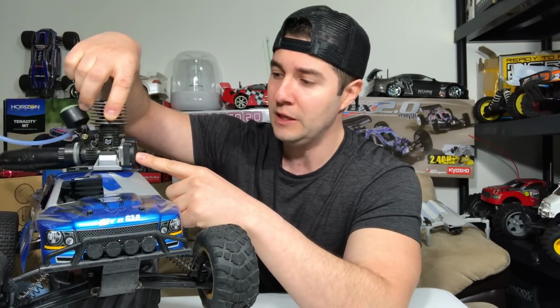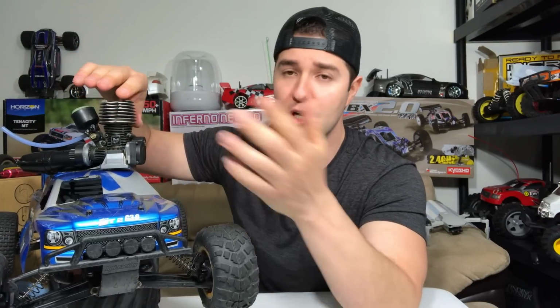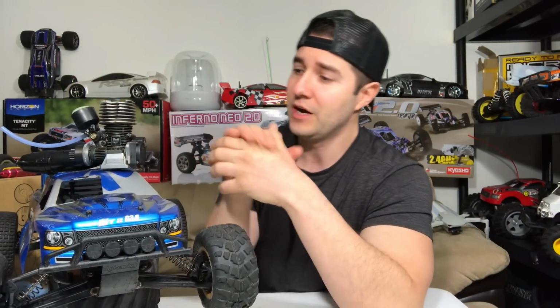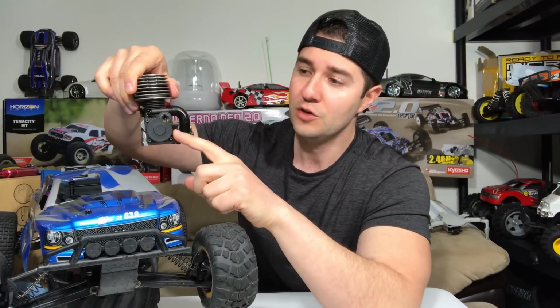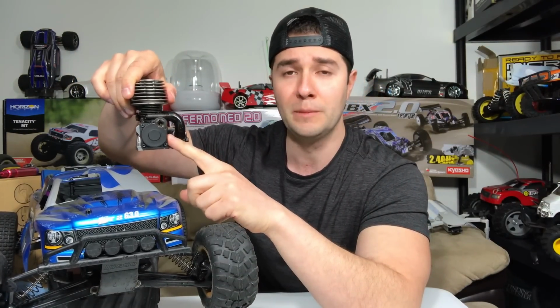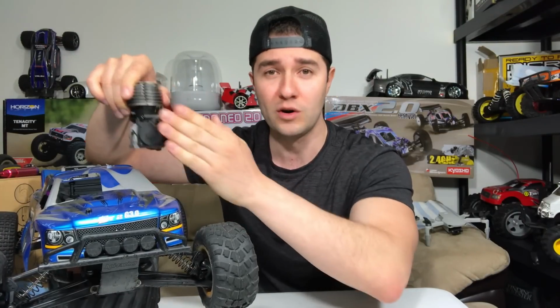There is a method people use, and I've seen this on Bug404's channel. Look him up, guys. He's one of my friends in real life and also a YouTuber I watch. Basically, the method is you remove the entire backplate assembly here. Your goal is to get to the starting shaft that the bearing sits on, and we'll do this in a little bit. You're gonna have to try to kind of score it a little bit.